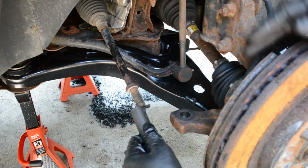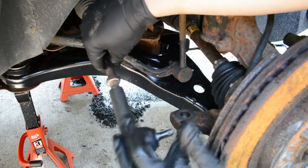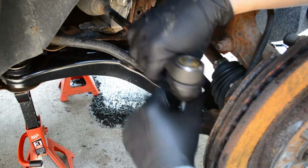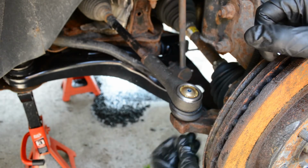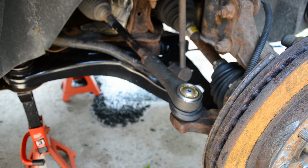The new end links I picked up are Moog, as I stated earlier. They are greasable end links, but these actually came greased, so you don't have to grease them today during installation. You can go ahead and thread them on until they hit the stop nut and then install it back into the knuckle. These do use a castle nut and cotter pin versus the OEMs that don't. I've never had a problem with these aftermarket units that do this. If you've had a different experience, please feel free to leave a comment.